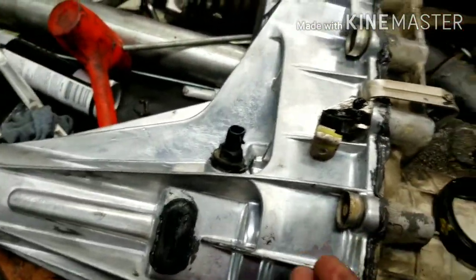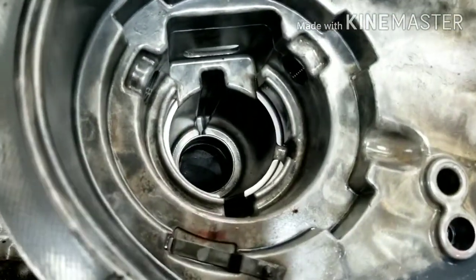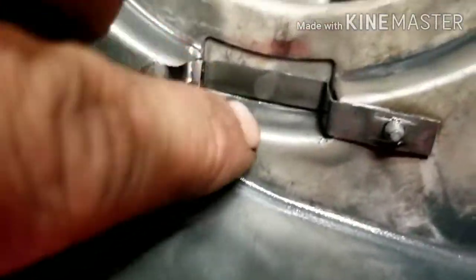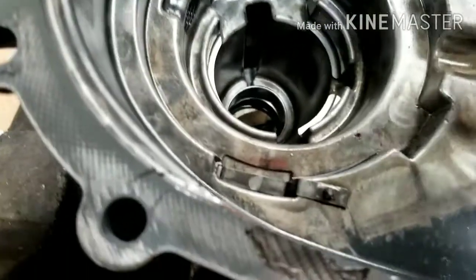You put it over your old piece and press the part in. Inside there's a square cavity where your pump rests, and there are metal clips — like shims — on each side to keep it from rubbing and creating a hole. The original didn't have that, but the aftermarket Dorman piece gives you those clips. You can see here where it's worn in — there's a hole right there, and on the other side you can see daylight through it. It's a really common problem.